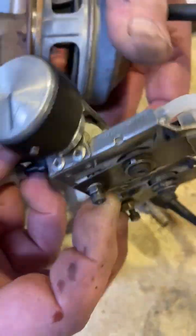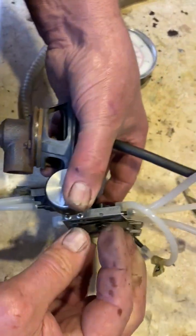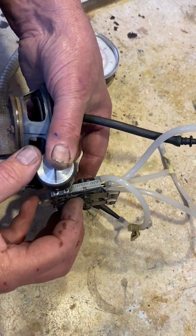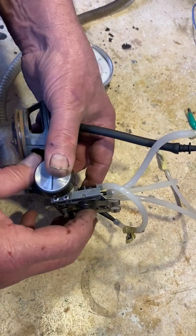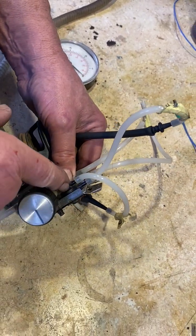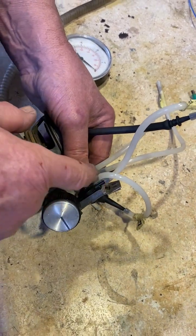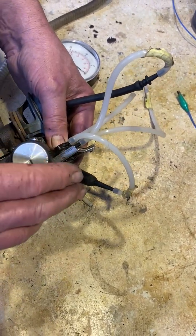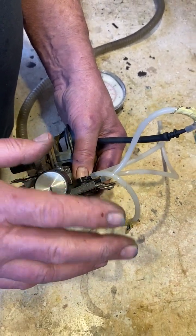here lifts this spring-loaded device right here and pulls up on a little umbrella diaphragm that either seals or allows leakage through a ball seat in here. Whereas, in fact, the actual variable venturi action is taking place between a tiny spring and a seat between these two halves. And to get those right, there are different needles, there's different seats, there's just too many combinations, but we've got this one working.